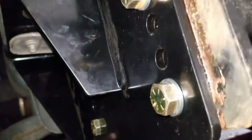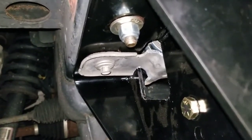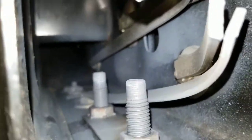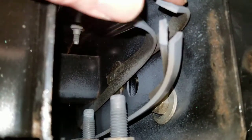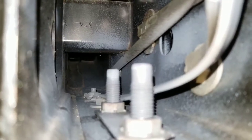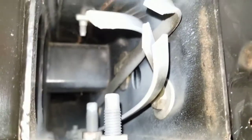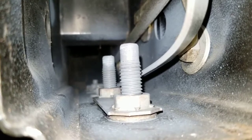The guys that install plows in my area said they just modify the lower intercooler support — but that's not how I wanted to do this job. This is my first Snow Way install. I can't remember what you call the bolts when they're welded on — the handle bolts — but that's inside my frame rail. After I cut the handles on the bolts, I primed them so they wouldn't rust. You're also supposed to use Loctite on the bolts, so don't forget about the Loctite.